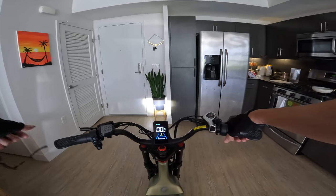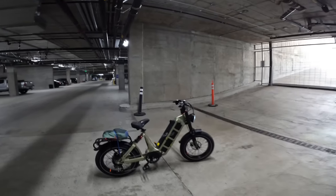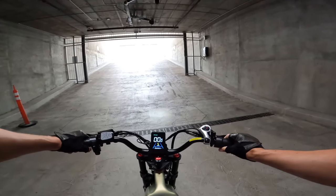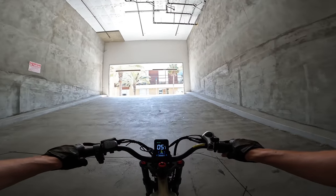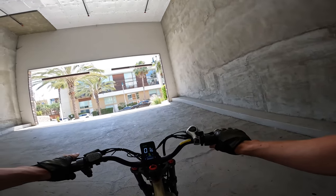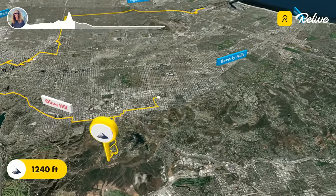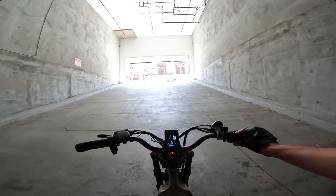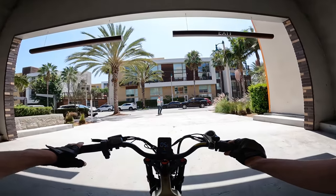This is the very first time I'm riding this bike — nice, good torque. So the very first thing we'll do is the 20% grade test on the Juliet. We have it on pedal assist 5, full throttle — and it's a decent little torque off the line, though it does reduce power somewhat. It is a very heavy bike at 116 pounds, but with a bit of a rollout on full throttle, no pedaling, pedal assist 5 — it's pulling us up the 20% grade.